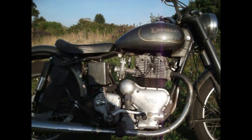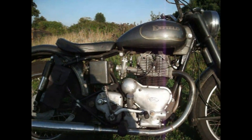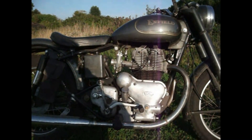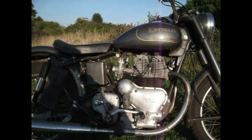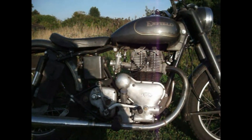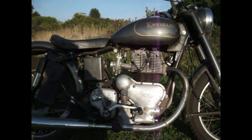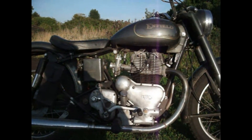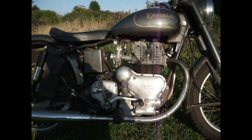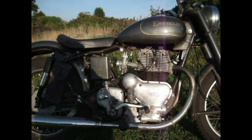The other interesting thing about the Meteor Minor is that these crankcase are identical to the 700s — they're the same as the Meteor 700, the same as the Super Meteor 700 — I'm talking about the old Royal Enfields from Redditch — and they're the same as the Constellation, although I believe they did beef them up a little bit for the Constellation. Because they started to hot the Constellation up to try and get more horsepower — they got up to about 56-58. They bumped the compression ratio up, put Redditch R cams in with a lot more duration and lift. It took its toll though — some of the Constellations ran on for months and years, but others blew up pretty quick. The cases had reached their limit.